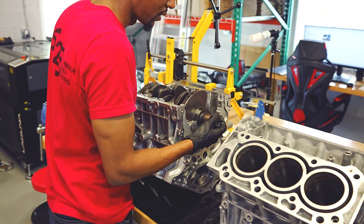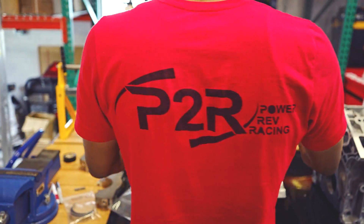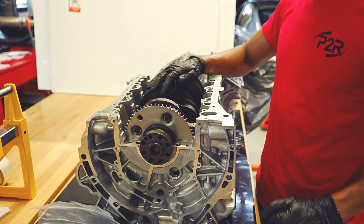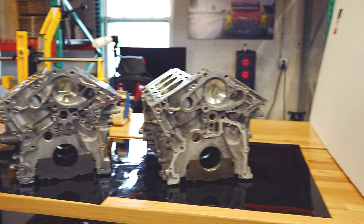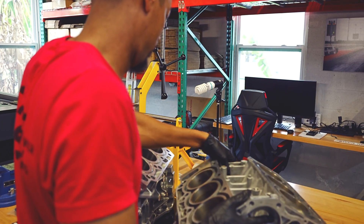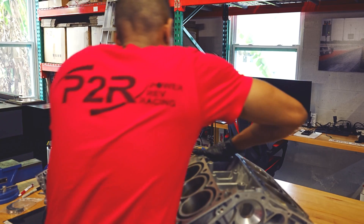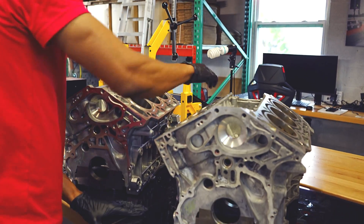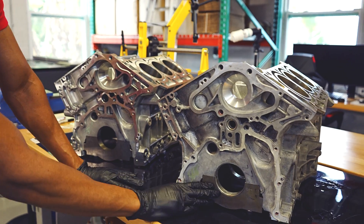So what does that mean? Essentially the J30AC comes with an 86 millimeter stroke, and what I got in here right now is a 93 millimeter stroke crank from a previous generation J series. So we're probably looking at like a 3.3 liter if we left it as an 86 millimeter bore, or somewhere in that area — I'd have to put it in the calculator to figure it out.